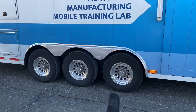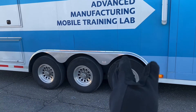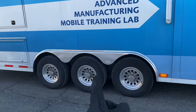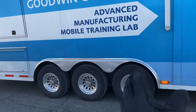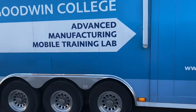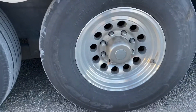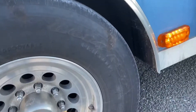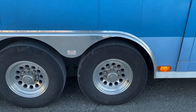When making turns, these tires are dragging quite a bit. They're designed to lean very steeply on these triple axles and pivot on the center wheel — the back one leaning one way, this one leaning the other way. Tires are very important: you have to use a very good quality tire. These are the Goodyear G614 RST tires — a very good tire, well known throughout the trailering industry and not the one you have to worry about popping on the highway.